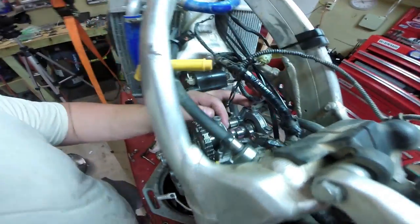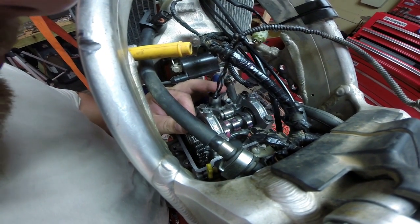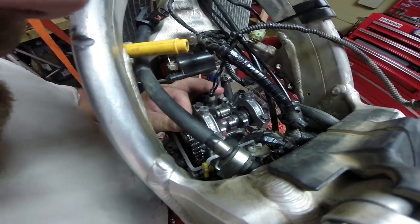Now we can put in the cam retainer caps. On this engine you have to be careful because the cam bearings are replaceable so they slide back and forth — you're going to want to get this lined up exactly, and be very careful not to drop these things into the engine. I'm using Redline Assembly Lube — I've had this bottle for years and built countless engines with it. It's basically just a moly lubricant; you run it for a couple hours, then change out the oil like you normally would, and it's like it was never there. But it helps with that first dry startup. Our cam lock retainers are in, you can see the cam has almost no side-to-side play — a little bit that's just in the bearings, totally normal.